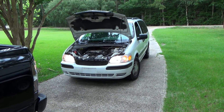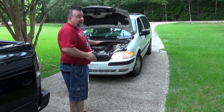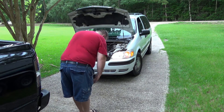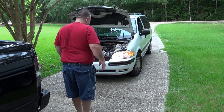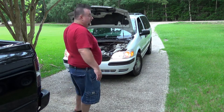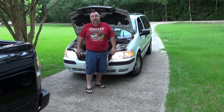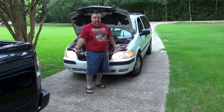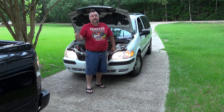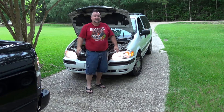Because it's about to rain I'm not going to do much adjustment, but I will show you how I would do it. The driver side should be a little bit higher than the passenger side, so I'll stand in front, see where the main beam is, and then move to the other side — this one should be lower. In fact it's slightly higher, so we'll have to make some adjustments, but we're not going to do that now — that's another day and I'll make a separate video for that. Hopefully you found this video helpful. I've seen a lot of complaints online about Chevy Venture headlights, so hopefully this will solve the problem for you. If you liked the video please click thumbs up, maybe hit the subscribe button — that goes a long way to help out YouTubers like me and keeps us making videos. I appreciate you watching and I'll see you next time.